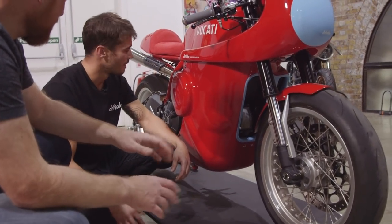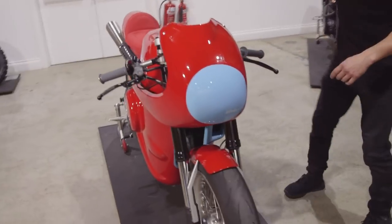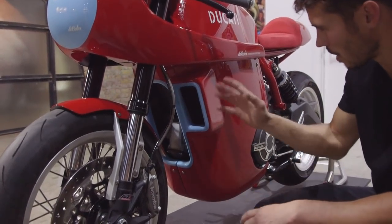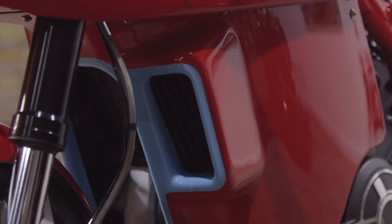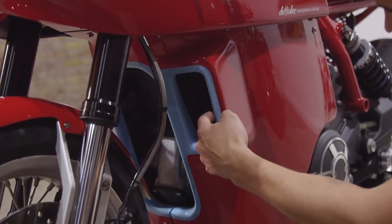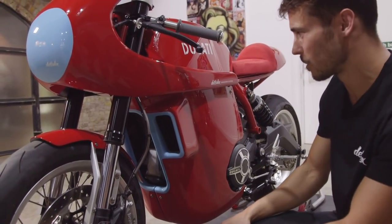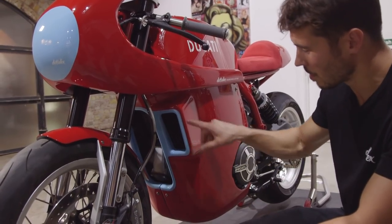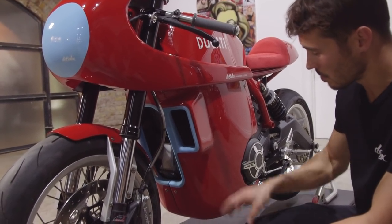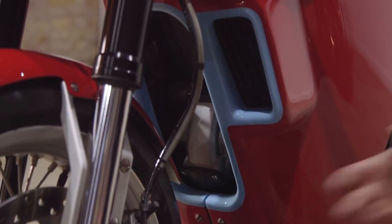Were there any cock-ups? The oil cooler was a particularly challenging part. We've done a few shapes like this and the process is similar, but this one was tough. That's the stock cooler slightly moved towards the middle of the bike. We start with making a wooden buck to beat out the framework, add sections, weld the frame, and then three pieces slowly grow together. You look at it and wonder how you're going to achieve that shape, but once you start, before the night's finished you think, 'Yeah, that looks good.' The middle hole uses exactly the same process — then we cut it down the middle and split the fairings.